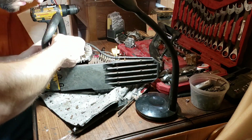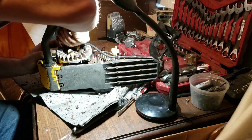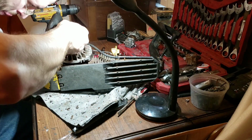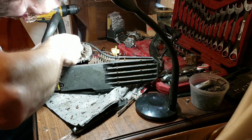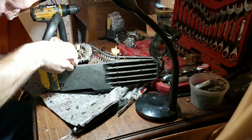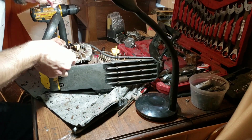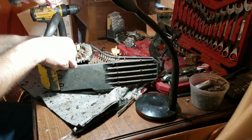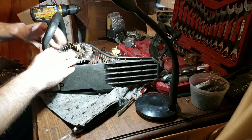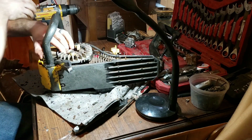I hope you guys can see. Almost should have removed that handle. There we go. So first, I can just hopefully shimmy that down to there. Are you happy? Alright, there's that. Press the coil up against the flywheel. And tighten.